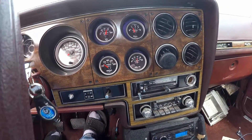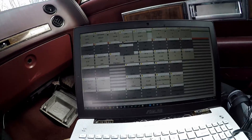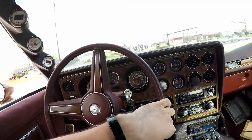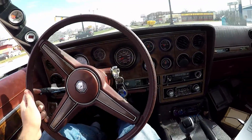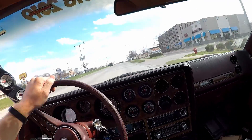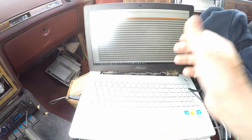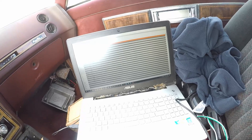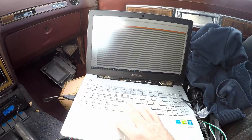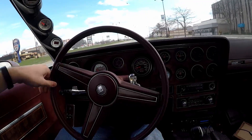She's happy now with that new throttle body — that made a pretty big difference. Fuel trims are getting a little bit better. As long as I hover around there, that's okay — I'll log it and adjust the tune for that. Fuel trims are very negative right now, which means they're taking away fuel, meaning there's too much fuel in there for it.